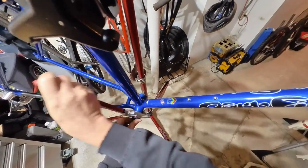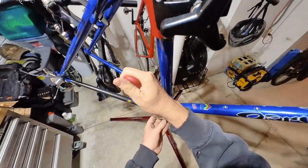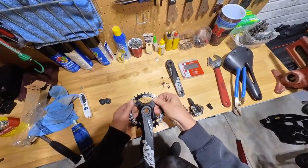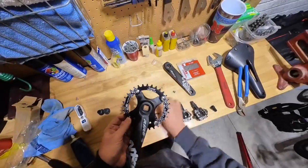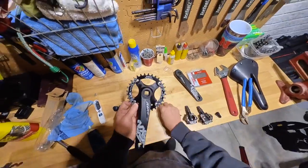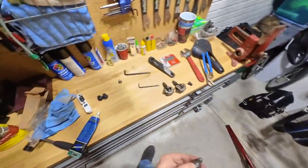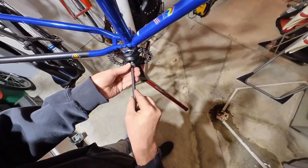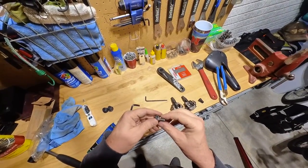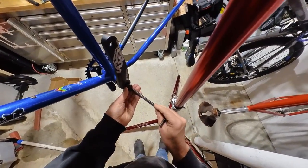Let's move on to assembling the cranks. I decided to buy these cranks when I saw them on Amazon for $35 including the chainring, because I was having a hard time sourcing an inexpensive chainring that would fit the other cranks. Remember to put a little bit of grease on the bolts that tighten on the cranks. Crank it down enough to attach the crank to the square taper bottom bracket. Repeat the process on the non-drive side and we'll continue on to installing the pedals.